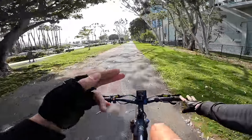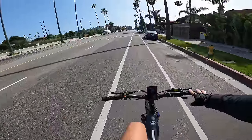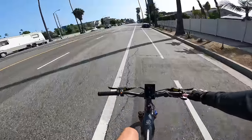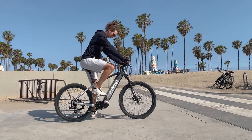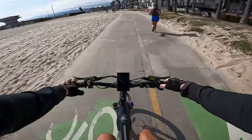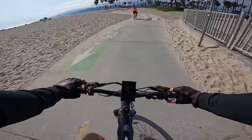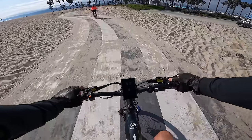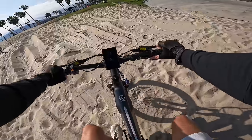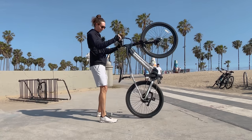At 6'2" listed max height, I'm 6'5" and I can tell this bike is a little too small for me, but it'll fit most people. When shifting gears, just let off the power momentarily so you don't tear up the gears. This bike probably has no chance riding through sand on this hill — the motor has enough torque, but the tires are just not wide enough. You'd need about a 4-inch wide tire to get through this.